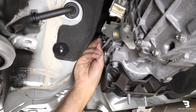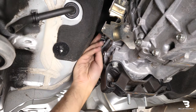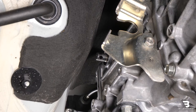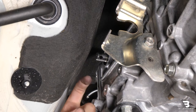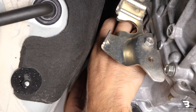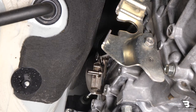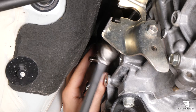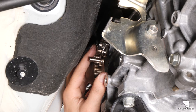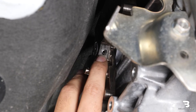Next I'm just going to put a little bit of anti-seize on this shaft — that'll help the plate be removed if you ever need to, and it'll avoid any type of corrosion. Now we're ready to install our shifter plate onto the shaft. We want to keep in mind the direction of the through hole in the shaft and align that with our roll pin. As you're hammering, take your time and wiggle a little bit just to make sure it's guiding into the hole properly. You'll know it's hammered in the whole way when the pin is flush with the shifter plate.